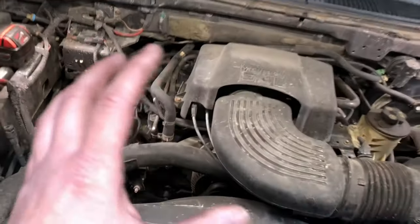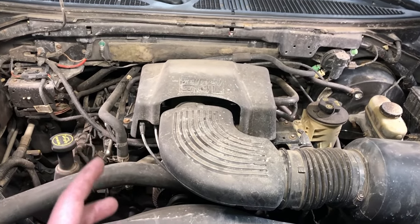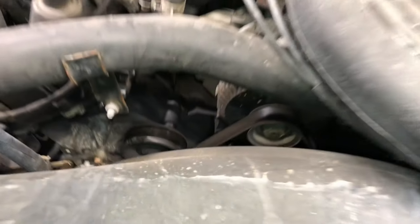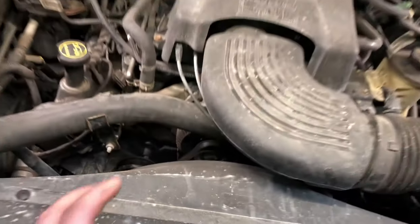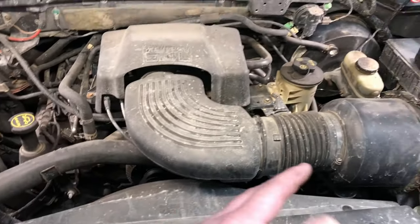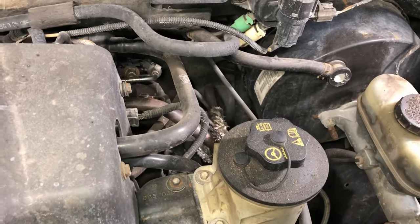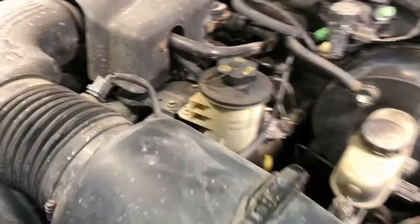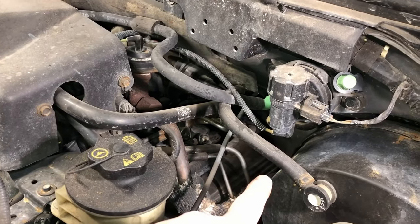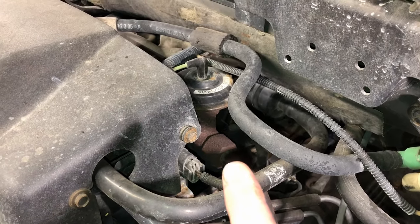Get the fan out of the way — it's a 36-millimeter hub nut — and then everything will start to open up. For this timing job, all you need to do is get into the valve covers and pull off the front cover. So just think about what's in your way: harnesses, hoses, vacuum lines, coils, brackets for the power steering reservoir. One thing you want to start soaking now is the EGR tube — spray some rust penetrant on the nut, it's an inch-and-sixteenths nut and they usually come loose.